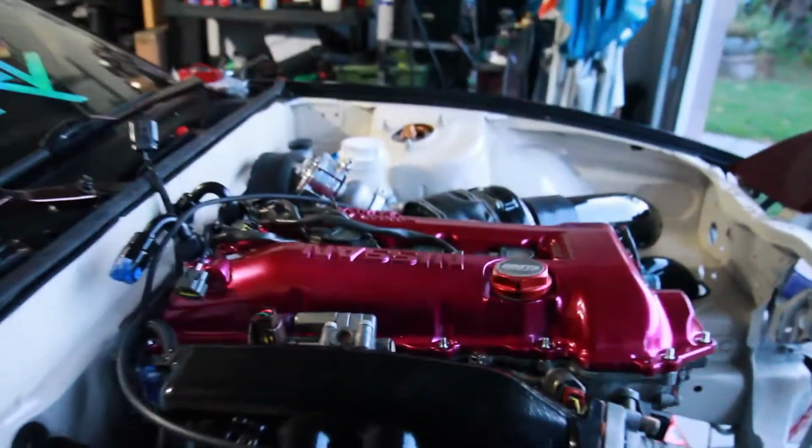So then I'm going to have it come through this way, routed on the cross member, going across, and then come over to this side, and then go into the hole, which is going to be somewhere over there. It's going to come through this hole right here, and then it's going to attach to the back brake line, which is right here. You can see it. I'm jiggling it right there. You can see it. Alright, so let me get that done real quick.